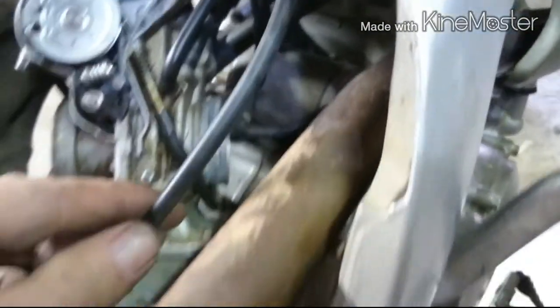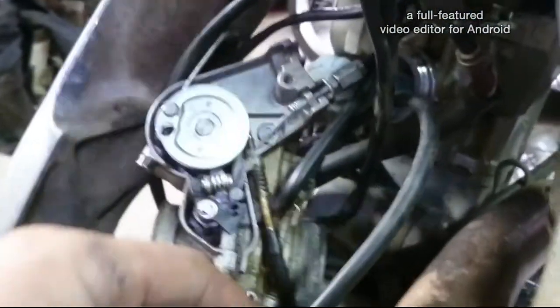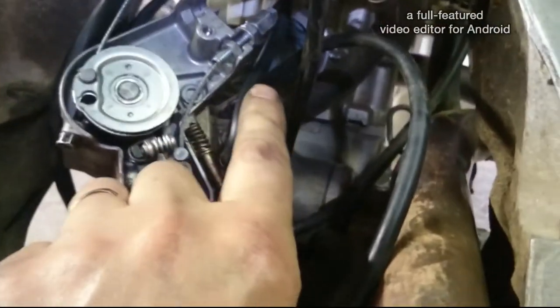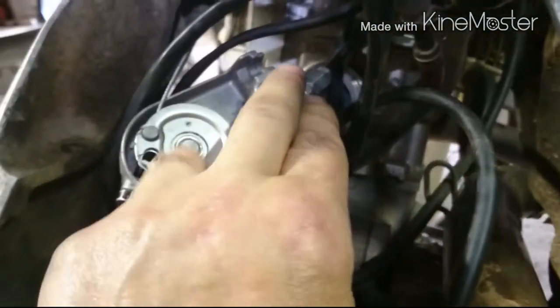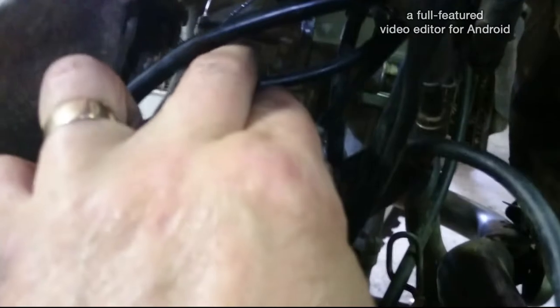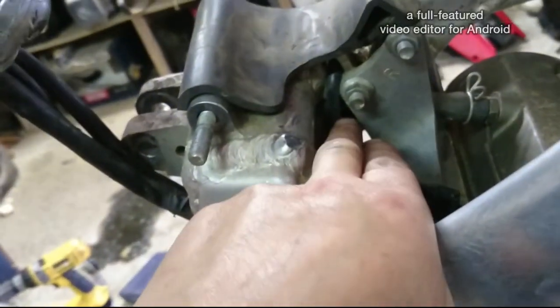Anyway, this one, when it's coming out again, we're going to have examined this one now. It's gone around the two wires, the live and the one for the starter motor and the earth. But the sneaky one, when that goes up at the back, it'll be to the left of these electrical wires, the earth and the live, and it'll go around the back of the push-pull cables for the throttle. That's the throttle position sensor wire, it'll be underneath them as well. And as I said, this is the one now, and it goes up there. Then when it comes up here, there it is there then.